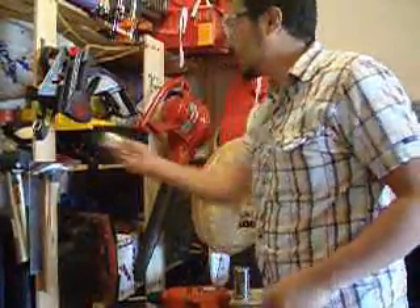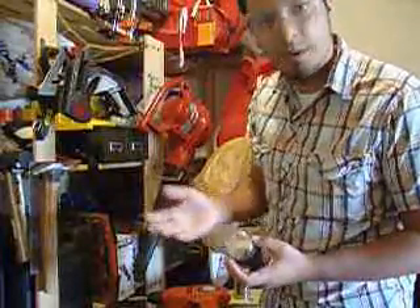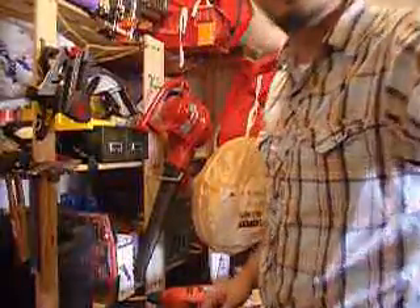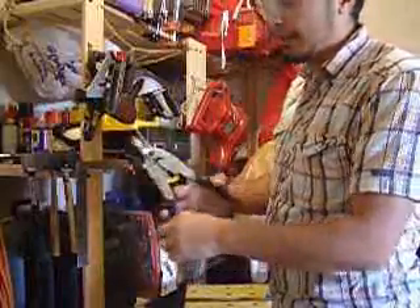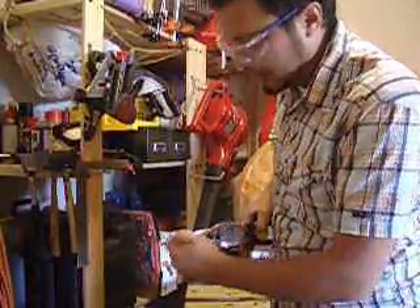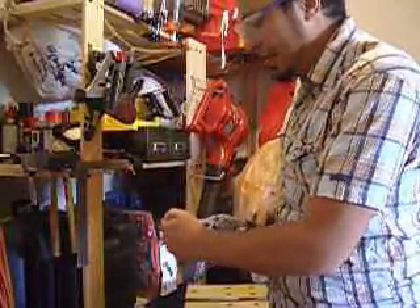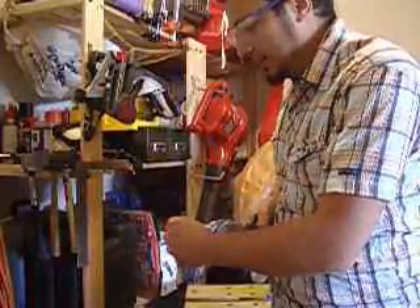Okay, so what's next? You have this. Sometimes I'll just drill this out, sometimes I'll take snips and snip it out, especially if I want to put wire mesh or something like this. This one says S. I think I might modify this, so let me set up a Dremel and I'll come back and show you how I do that. So, essentially I just drilled a couple more larger holes with a step drill, and I take my tin snips and I'm just sort of cutting out a pattern around it. Eventually what I'll do is I'll just use some mesh inside there — it'll look much better than it would with an S on it.